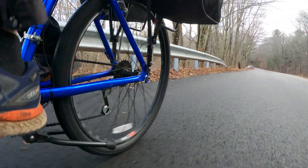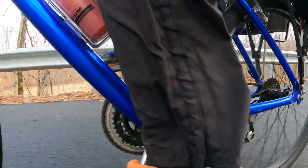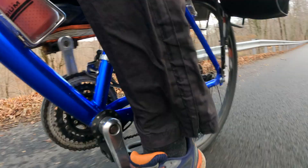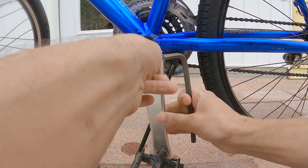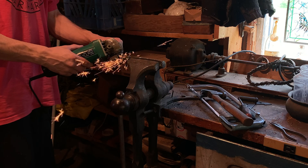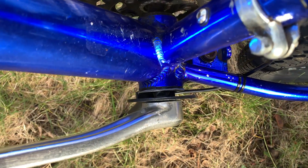The first hundred miles on this bike was the hardest. At first it was great, but then some stuff started going wrong — we'll call it the breaking-in period. After about three trips, my crank arm started coming loose, and every time I tightened it up, it would just loosen up again. That's because I didn't grind it down far enough to fit the pedal assist sensor, so it was never fully seated. That was an easy fix.